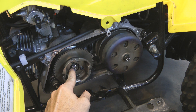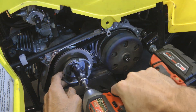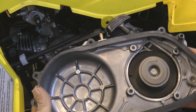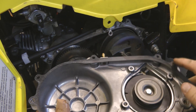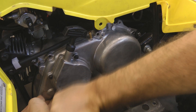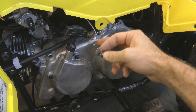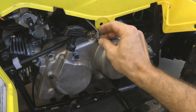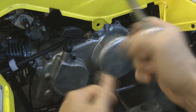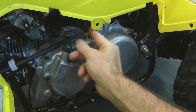There probably is a torque spec for this nut but I don't know what it is and I don't have the special holder tool, so I'm going to use the small impact with a 17mm socket and give it a couple of good whacks. Then take your outer cover — make sure the gasket is in good shape, make sure both dowels are in place — and slip it back on and match it up to the case. Replace the five 10mm bolts; on the top one, if you've got a ground cable like I do, make sure you reinstall that. Snug these down but don't go crazy since this is cast aluminum — you don't want to pull the threads or strip anything out. Then make sure you put your breather hose back on up here.